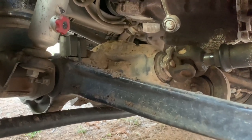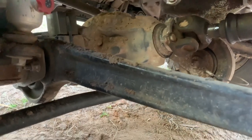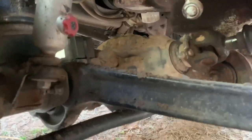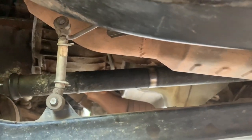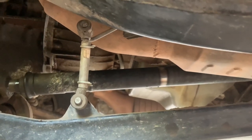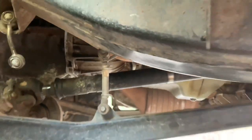But you can see I've used the rubber block there, and that's bolted down to the pad that it sits on. So all standard bump stops, longer brake lines, a flat spacer, and the Terra Firma plus 2-inch shock absorbers there, and then the height sensor mods. And that's all I've done. There's no rocket science in all of this. It's pretty basic.